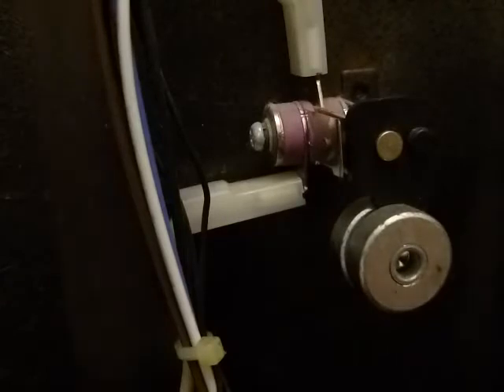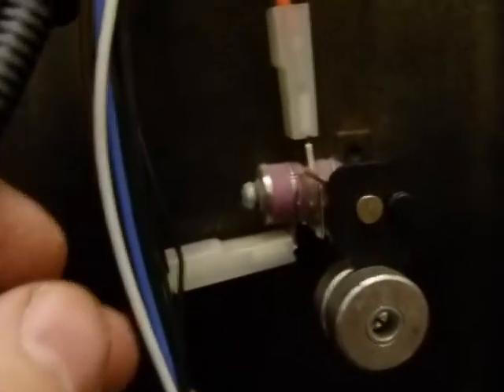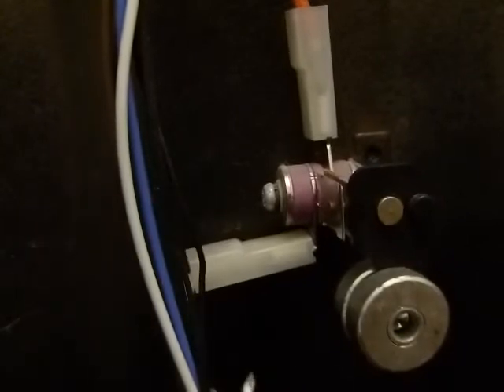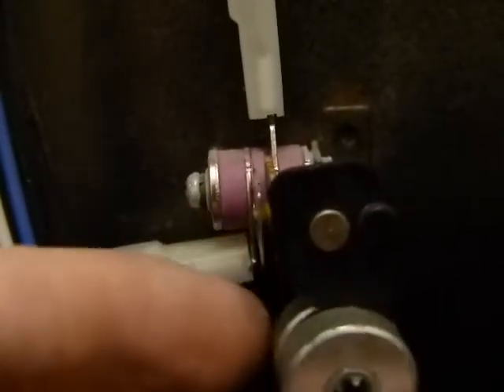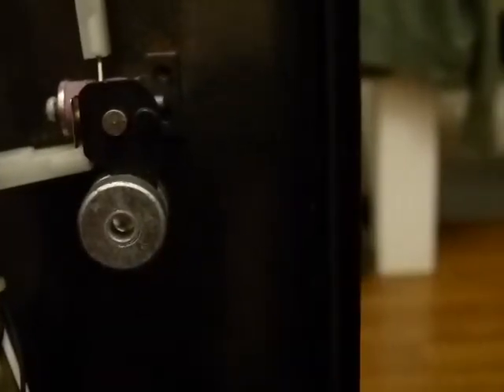Another easy-to-check item is this switch here — it's the tip-over switch. It's got two wires coming in, one white and one red. In its normal position that contact surface should be closed, so it should beep — and it does. As I move the cam lobe, it should stop beeping — and it does. Vertical: good. Out of vertical: open. Yeah, that switch works fine.